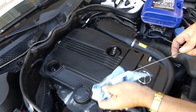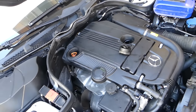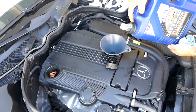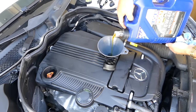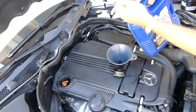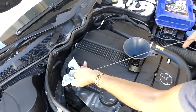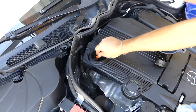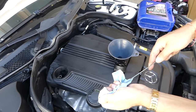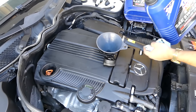The oil level is a little less than half, so we'll add about half a liter more to be safe. The oil filter housing will take some oil, causing the level in the pan to drop. It's very important not to overfill — some vehicles even have a label warning that too much oil can damage your engine and catalytic converters. Never exceed the maximum mark on the dipstick. Ours is in the middle, so we'll add a little more to bring it to about two-thirds full.